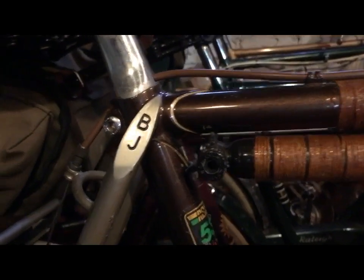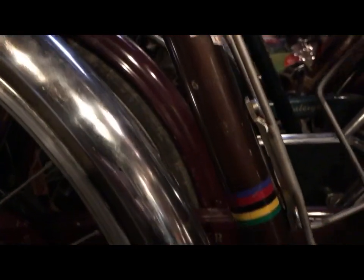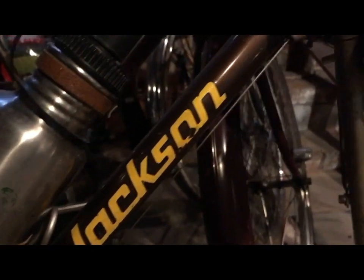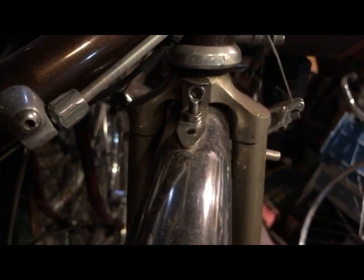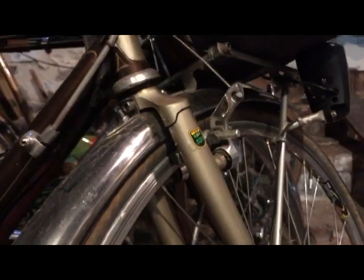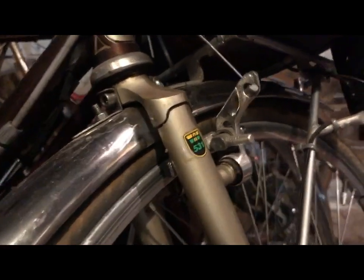My complaint about this bike — if you look at my video on it — is mostly centered around the front forks. It was built as bikes were built at the time, and by modern standards and changes in knowledge about tyres and suppleness, the forks are too narrow. That fork crown is not wide enough and the fork length isn't enough, so the clearance above is not enough to take anything more than a 32mm tyre — and that's a squeeze. The original Ritchey Logic cantilevers are really just a tad close together.